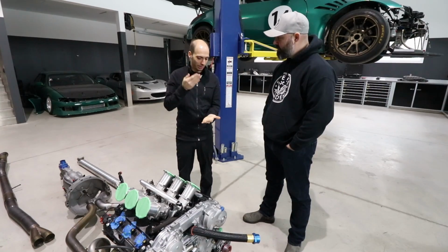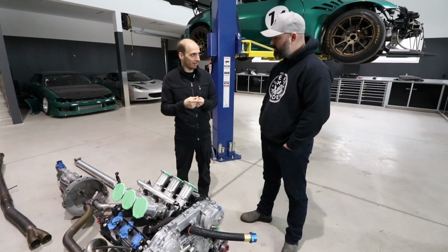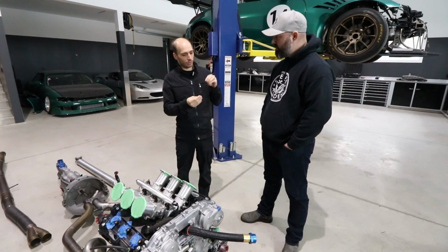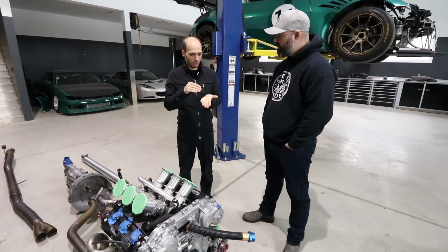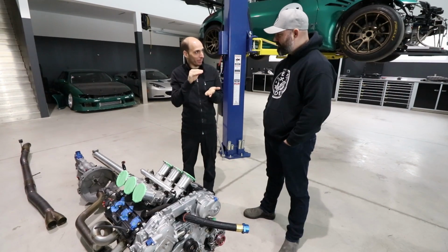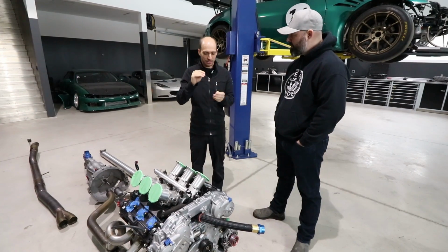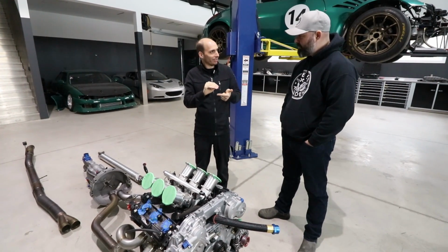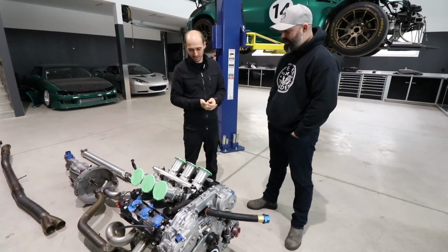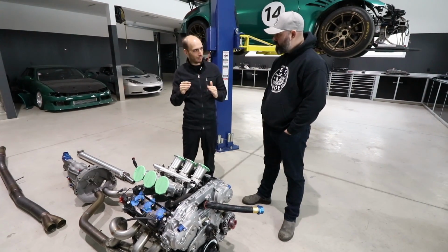We have the crankshaft just fitting on the pan. We have the crankshaft just clearing the block and the oil squirters, and the piston reliefs on the intake just barely fit where the ring grooves are. And then we just barely fit the valve that we wanted to use with the stack-up that we could get for the spring and then the retainer. If you go from bottom to top, you can literally see we basically use every millimeter of deck height. There's no space left. Even with the porting, the engine's at the limit in many different areas.